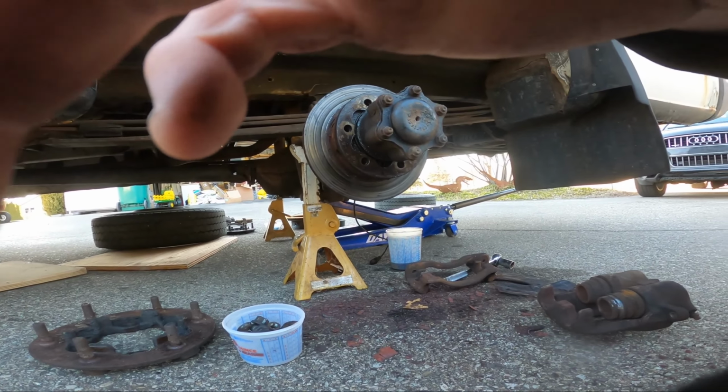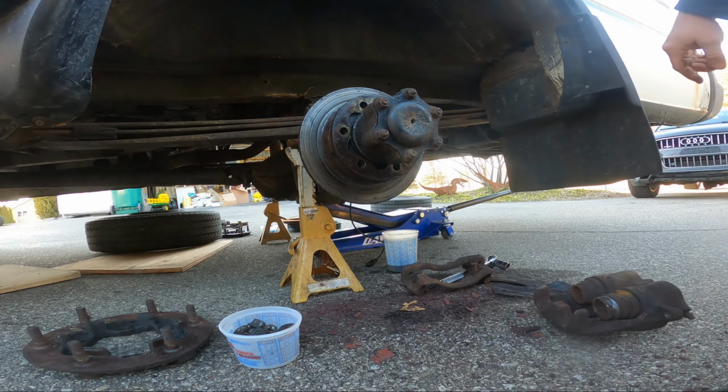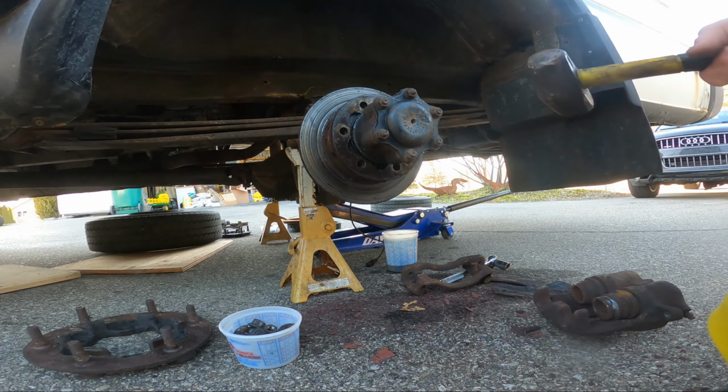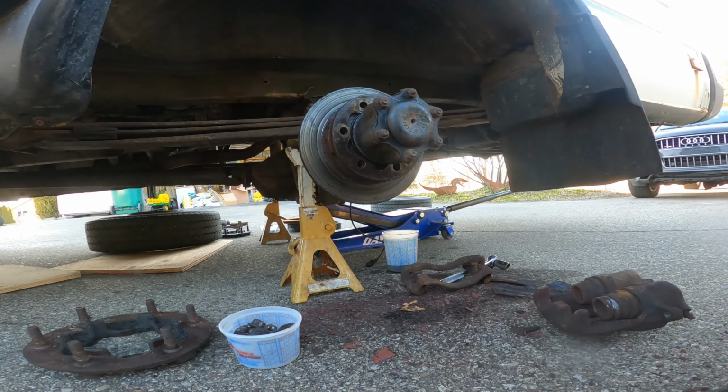But I was about to get the welder. If you weld a bead along here, usually that's enough heat to pop it off without injecting too much into like seals or something in here. Well, if I have to do a wheel bearing from all the pounding I did, then at least the brake parts would be new and they'll come off easy.